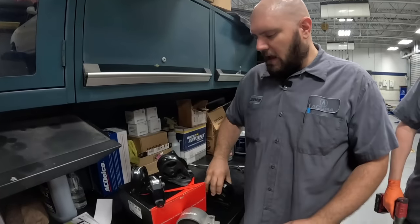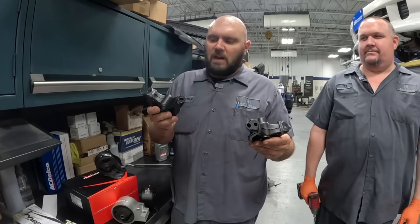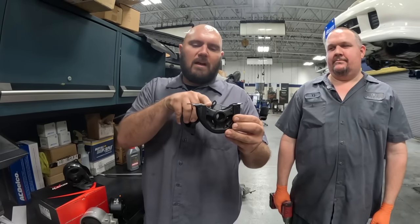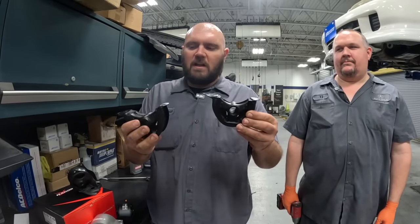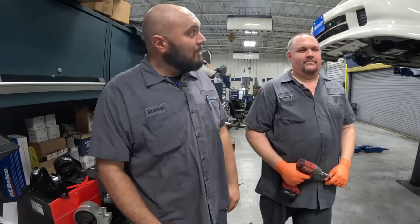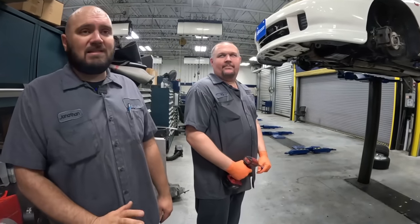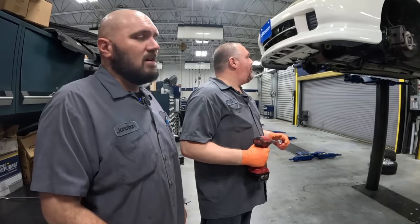So this is a good happy medium between solid mounts and stock mounts. And it's a complete kit, comes with the mounts for the AC compressor and transmission. If you've seen the AC compressor mounts, normally they're not really a mount, it's like a vibration dampener. It's like skinny little rubbers. This one's solid like the transmission. So this is actually gonna give the car some pretty good feel from the mounts. Only problem is getting that back one out of the car, it's not so easy. And this is stock and it has almost all the stock brackets and clips and everything. So we're gonna go at it and see what it takes to get it out.